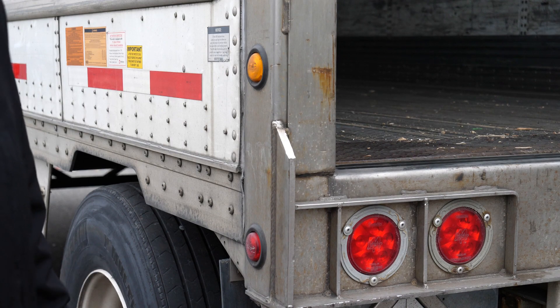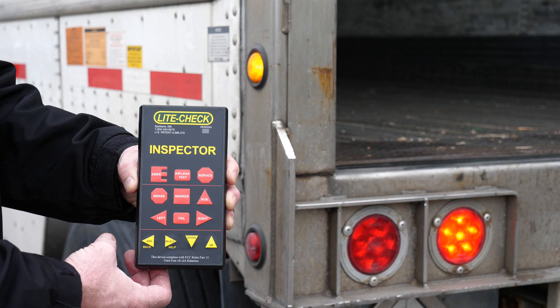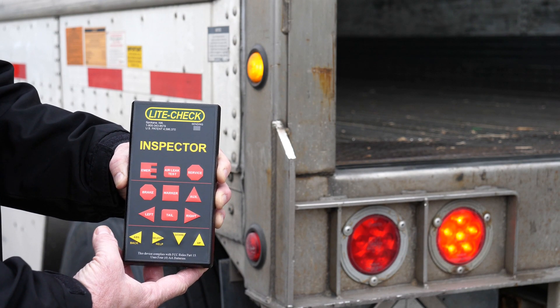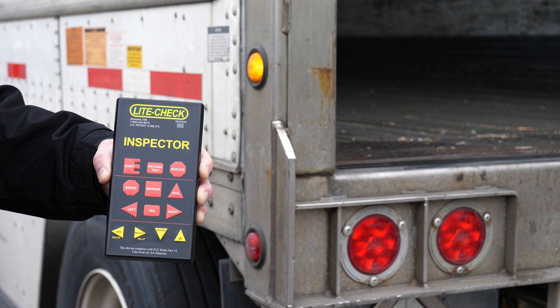At the rear left corner of the trailer, you can perform the preliminary 1-2-3 ABS operation. Step 1: apply the brake circuit. Check — does the ECU activate? Does the ABS warning lamp turn on and off? Now turn off the brake circuit and apply the auxiliary circuit. Check again — does the ECU activate? Does the ABS warning lamp turn on and off? You may also hear a clicking sound from the ABS ECU from underneath the trailer. This can also help in diagnosing whether the ECU turned on or not.